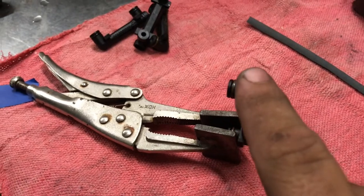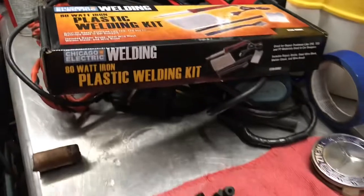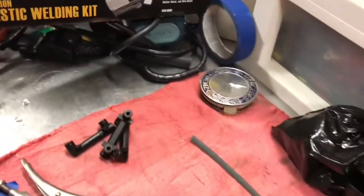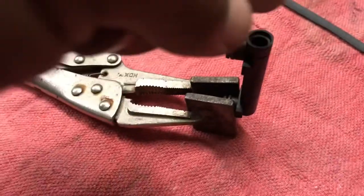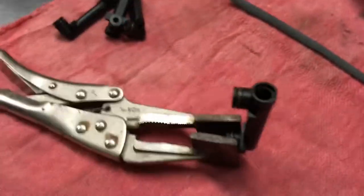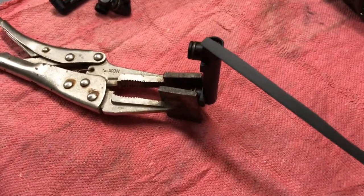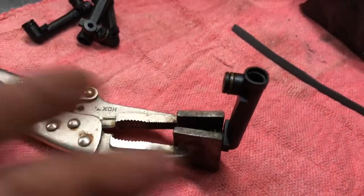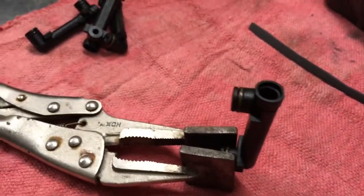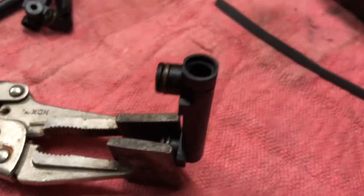So what I'm going to do with these is I'm going to fill this in right here, I'm going to melt this right here. I'm going to be using this plastic welder right here. I've got my iron heating up already, it's been heating up for like five minutes. I'm going to melt this right here, melt this around, then start hitting it with some plastic filler. This is the filler that comes with this kit. I'm going to melt it, weld it all together, then plug one end up, put an air hose on the bottom with very light pressure — you don't have to blow the whole thing apart.